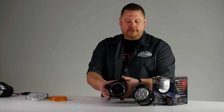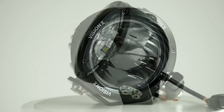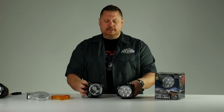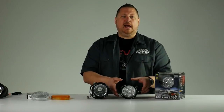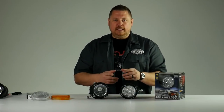The other major improvement going from the first generation to the second generation is the invention of the multi-LED cannon. We go from a single 40-watt LED to multiple LEDs at 49 watts. The multi-LED is just a massive assault of light — unbelievably bright — but you sacrifice distance. The optics are not designed for super long range like the single LED version, so you go from a long-distance beam to a medium-distance beam. It's about half the distance of the single LED.